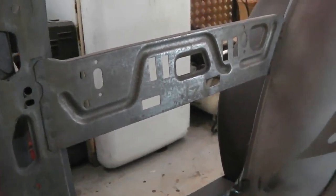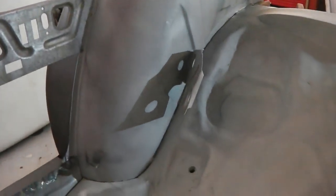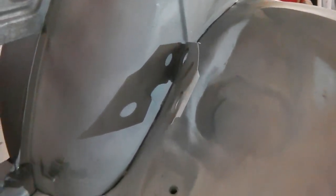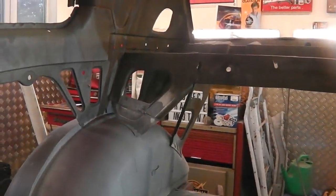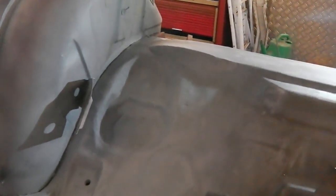So it's Foss Clean B time first, seam sealer down, and then weld into that bracket there, seam seal around the bung, seam seal around that bung, tar pads down, then overpaint it brown. And that's tonight's session done. And this quarter area here, this little square shape, should look quite good.